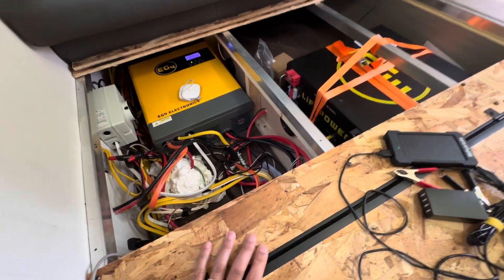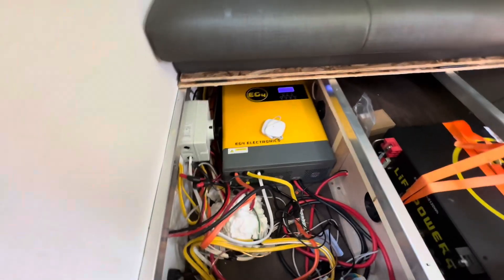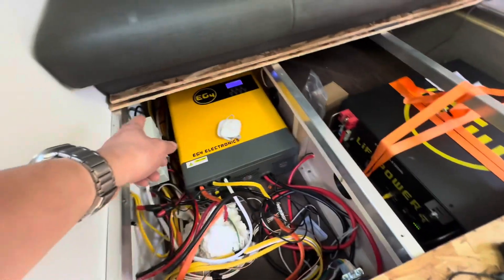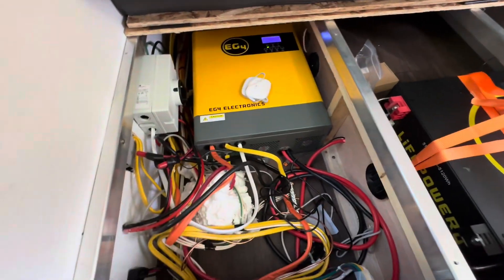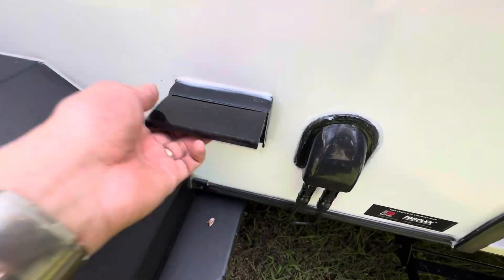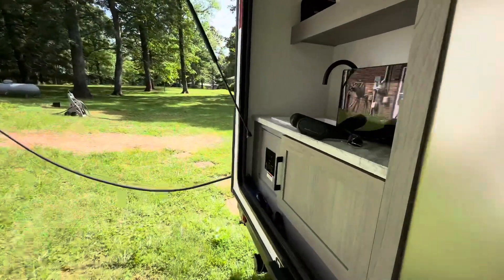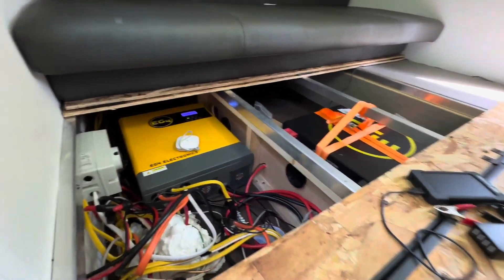A lot of issues that people are having with setting up an inverter in this RV is that there's no documentation on how to do the inverter prep. So, there are two ways — you can either cut the yellow 120-volt AC line that has the label 'inverter prep' on it, but you have to realize that the inverter prep line is actually just tied to the breaker for these outlets. And these outlets have little lightning bolts on them — the one in the kitchen has a little lightning bolt on it. So pretty much that cable, the inverter prep marked cable, is only for the outlets.